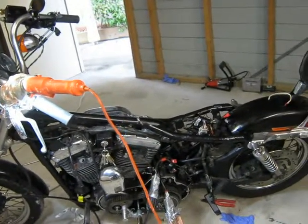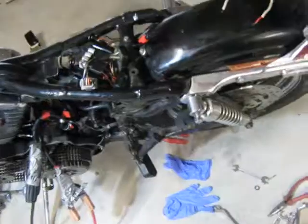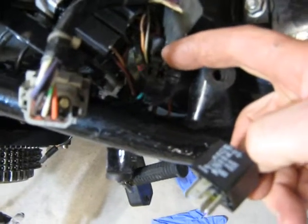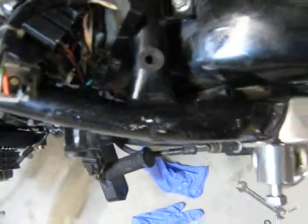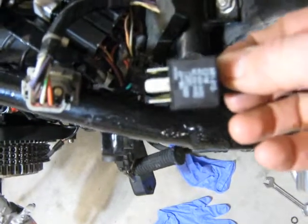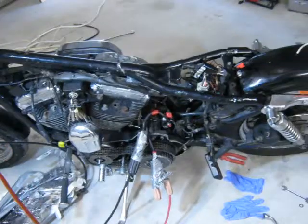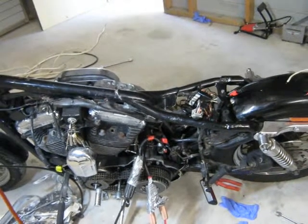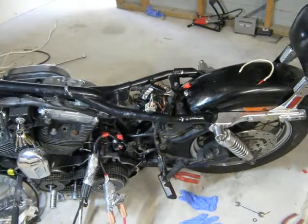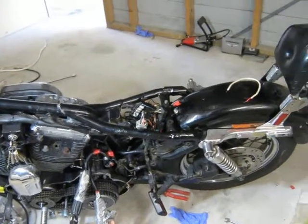At last I've made a good breakthrough with the problem with the starter motor. The starter relay plugs into this junction here — that's the joiner there. What I've found is that if I get a piece of cable and bridge, bypass this relay switch, running a cable from there to there, I can get the starter motor to work. Before I go any further, I'd like to say that I'm not a mechanic — I can keep a car running, but it's going to take me about ten times longer to diagnose a problem than a mechanic. I don't recommend that you try this test; if you do, you want to be very safe and understand what you're doing.